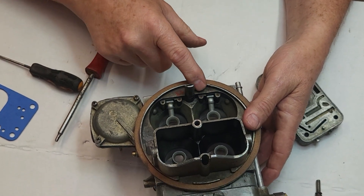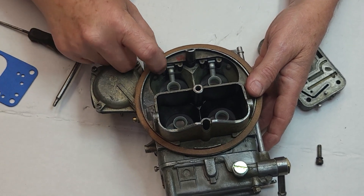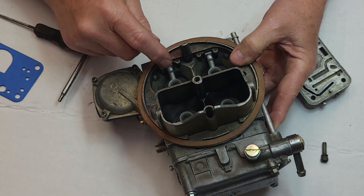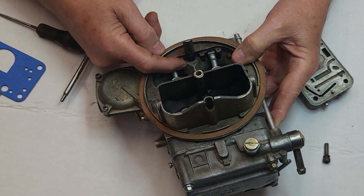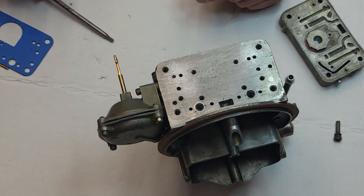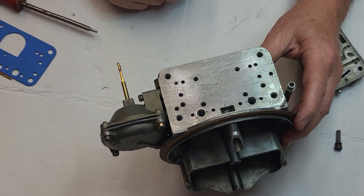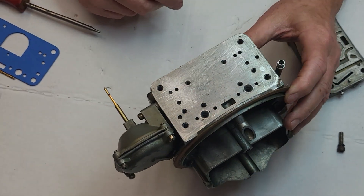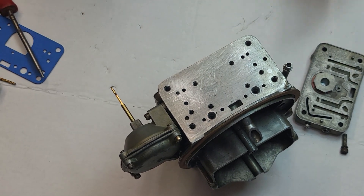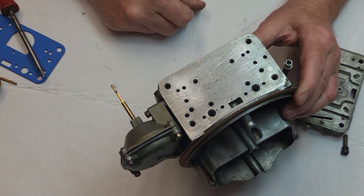Now we're going to also modify the air bleeds — we'll do that in the next part. We're going to make them square. If we've got 70 up front on the idle, we're going to have 70 here. I think I had 31s in the front and 28s back here is what came factory, so this is going to be 31s too — and it might even come out 32 or 33 when I get through. After we get through all this, we've got to get it all tuned out. There might be something here you're going to like at the end of this build — we might do a raffle on it, I don't know yet. I don't want to commit to it, but I believe we're going to do something like that. We're through with this part, so comment, like, subscribe — please subscribe, that helps us. I'll see you for part three right shortly. Thank you.